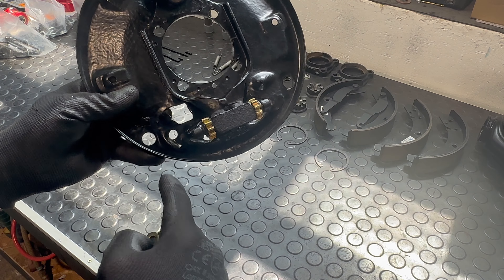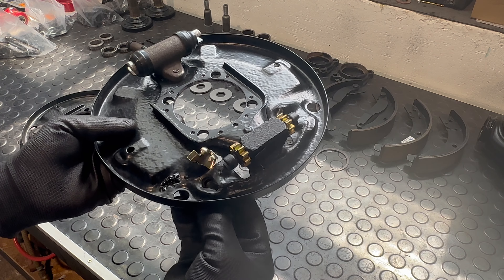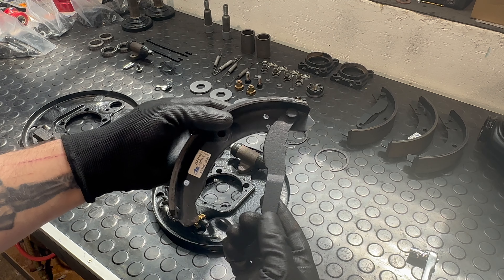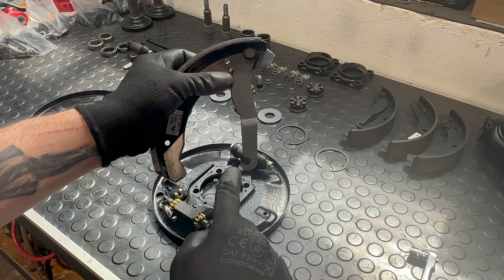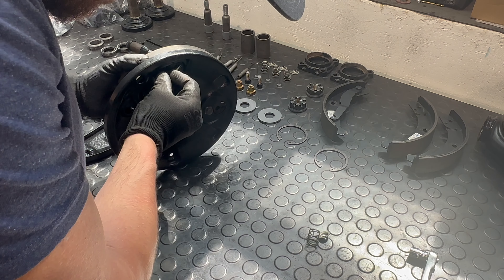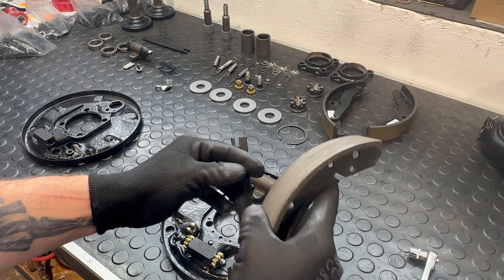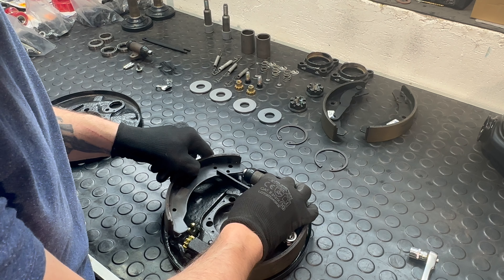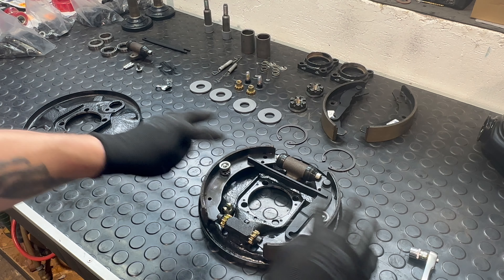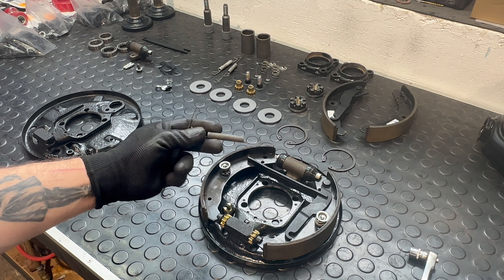Now this piece goes in here, secured by a bolt — we will put it in like that. This stops the handbrake cable right here. Now the brake shoes — I already installed those levers. This is the handbrake lever, so the end of the handbrake cable goes into here, and we will use this to hold that in place. Now this piece with the brake shoe, and now these two to keep everything from falling apart — the longer one goes on the bottom and the shorter one is right here. I've done it once and I think it was tricky to do, so let's see.